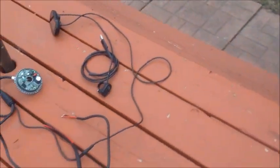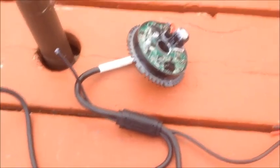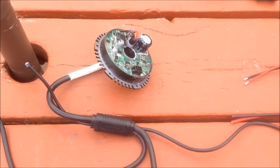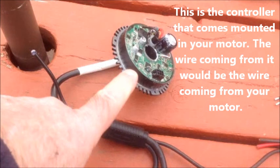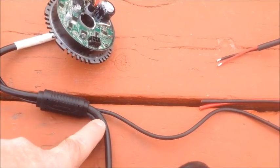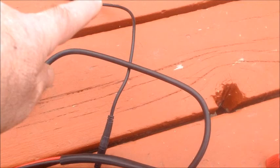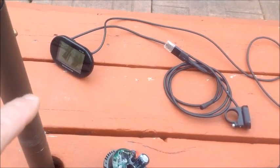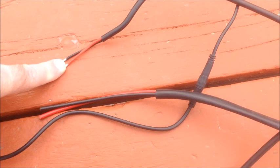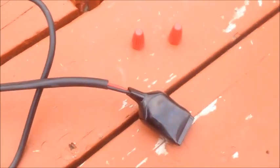Here's how the wiring is done. This is a controller — a Magic Pie 5 controller, Edge controller, Smart controller, Smart Pie — they're all the same, just at different settings. There's a main wire that comes off the controller from the motor and comes to a housing that splits into three wires. One goes up to the Smart Display, or you can plug in the USB cable into it. Another wire runs along all the way to the battery attachment — that's the red and black wire from the motor — and if you have one of our batteries you just attach and twist the red and black wires together, or use connectors to attach them.